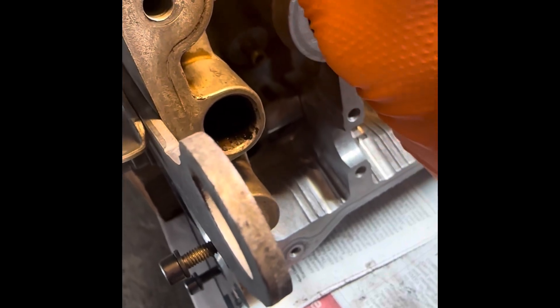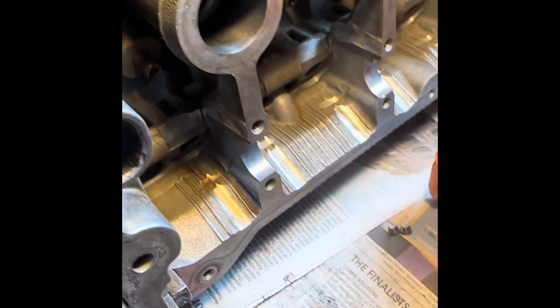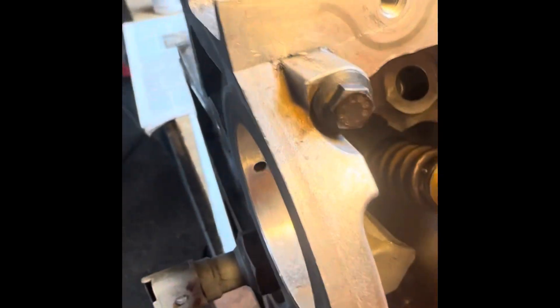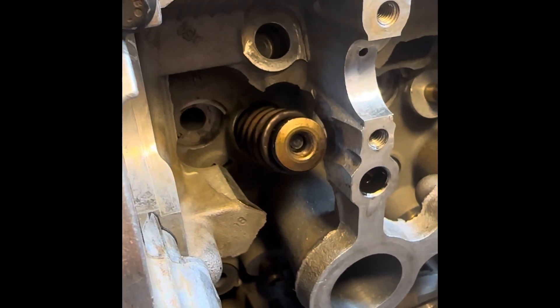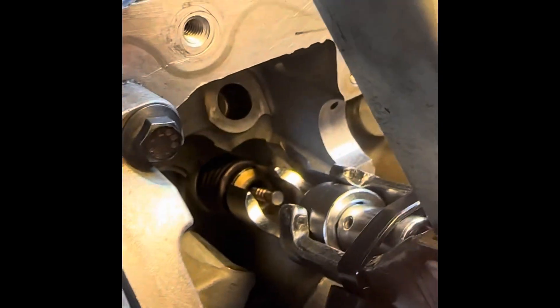So now we're going to look to put the spring on and put the collets on. We've taken our clean spring cover, put that on there - that fits in there like that. Lovely. So now we can get our valve spring compressor on. There are your two little collets there. I'll put them here, just make sure they stay clean. So now I'm going to compress that and try to put the valve spring compressor on. I've had to modify it slightly by using an injector-type socket because there wasn't enough space - these are quite deep, especially in there. That's in there nicely now.